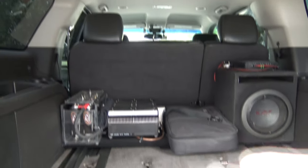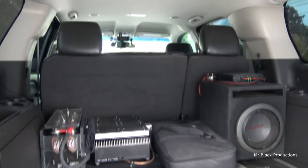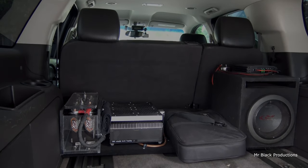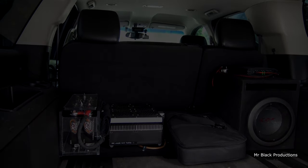And what it ended up being was every time I fired down, the RF was getting on the rear defroster elements, running back through here, running all the way up into the computer, and the computer was shutting the truck off and had nothing to do with the fuel pump. Although it would show as a low fuel pressure or a low fuel pump issue as the code.